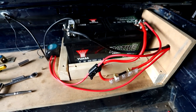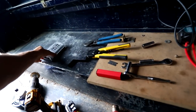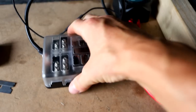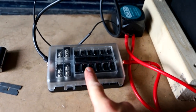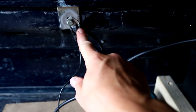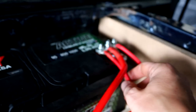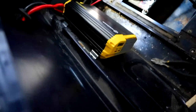That's the wiring done for the inverter and the split charge relay. Next job — I've screwed the fuse box down: that's there, that's there. All the power is going to be run from here now, so anything I add — lights, fridge, diesel heater — everything goes through this fuse box. It's grounded there, the positive goes around here, and then I've put a breaker in just in case I want to turn everything off. Then that goes to the positive — that's pretty much it. Now I just need to box it in. Let's check if the inverter works.